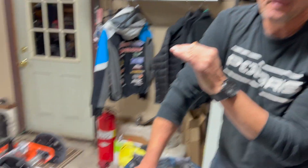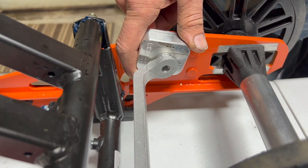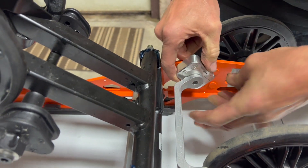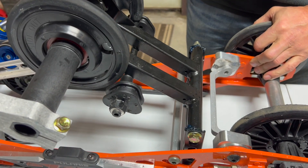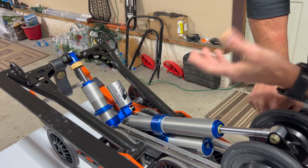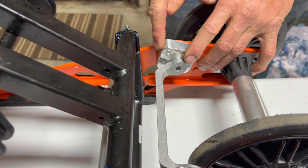Which goes into the boost - they've got these new blocks, a four-sided square block. This one actually has four different sides or settings. This is set on the highest setting and you can pull these blocks, twist it, and it snaps into another position. So this is the highest setting forward - when you hit the gas it hits there almost immediately, meaning least amount of transfer. Being that it's so far forward, it actually takes pressure off and then from geometry comes back up. So it's a crazy amount of block specifically designed for less transfer.